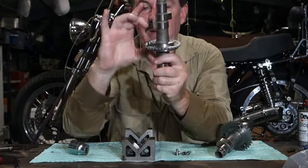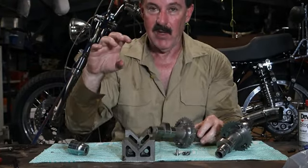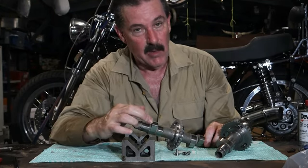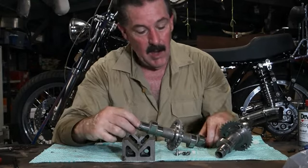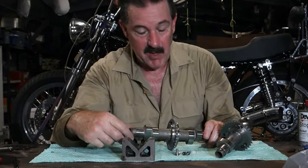So they're not going to back out. But what if the clamping force is not enough to overcome the resistance of this engine? And I should tell you that this is quite a big cam for a street bike. As I said, it's a Megacycle 250-30, which is not a race cam, but it is at the upper end of what you would put in a street bike. So that means that it has way more lift than the stock cam. So you're trying to compress the valve springs more than you were before. I dare say the opening ramps are a little bit steeper, so you're trying to compress the valve springs not smoothly, but abruptly, and as I said, there are times when you are trying to compress probably 3 valve springs at once.